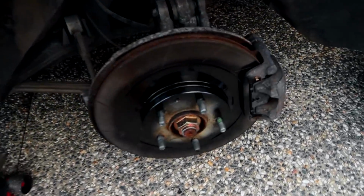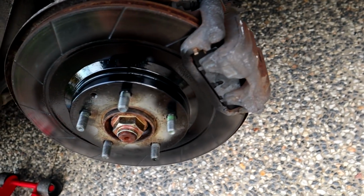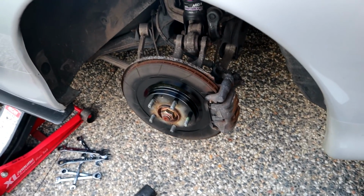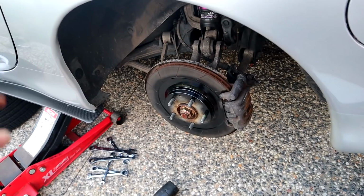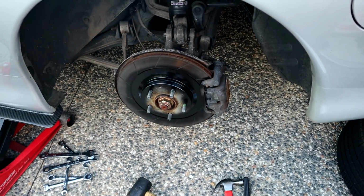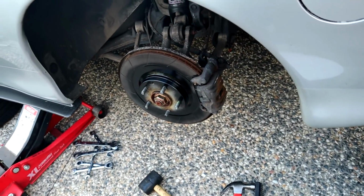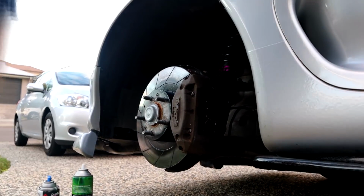And now we're going to start with pulling apart the brakes and taking out the pads, and then we can mask the whole thing up. So that'll be no worries at all. So I didn't realize, I'm stupid, but the foot brake and the handbrake are all in the same caliper. So I'm going to just leave the thing on, and I'm just going to mask it all out. As long as I'm not shooting paint all the way up there, we should be completely fine. So yeah, silly me. I'm going to put those bolts back in and make sure they're all tight. I'm stupid.